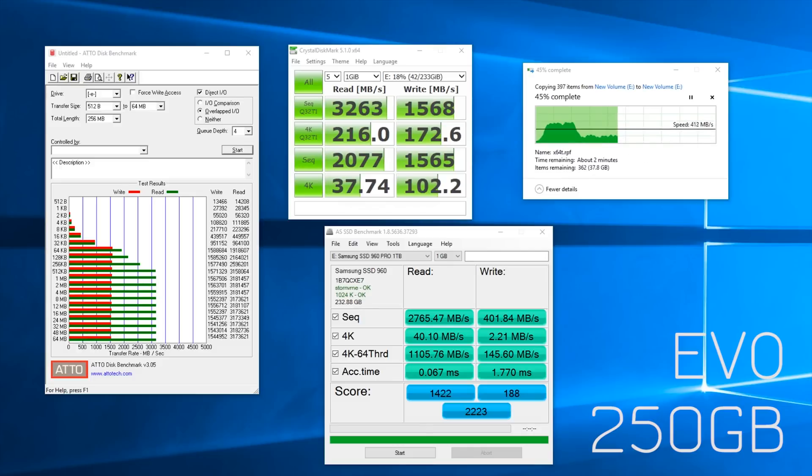In the more real-world GTA 5 copy test, which hits the reads and the writes, that was about 200MB per second average slower than the Pro. But after around 13GB, the speed for the Evo just utterly crashed to about 200MB per second, as you can see here. That's a really very slow speed for an M.2 NVMe X4 SSD, and this is potentially due to the SLC buffer issue as well as the thermal throttling issues.